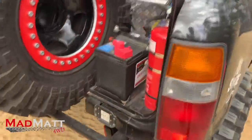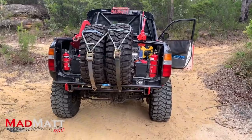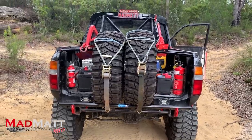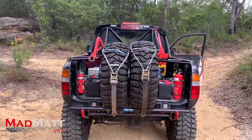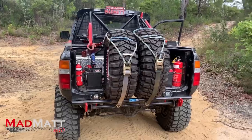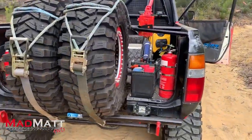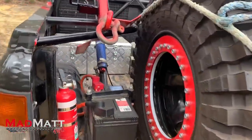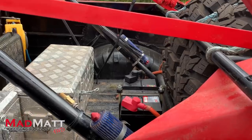Let's come up and look at the vehicle from the back. I love the look of the trophy trucks and unashamedly I've gone with two spares on the back. On race day we'll probably only run one of those spares, but some of our races are 150 kilometres long — that's why I needed the ability to carry two spares. This battery and this battery are for the 24-volt system. This battery here is the 12-volt system. So I'm running three batteries in the vehicle, completely separate systems.